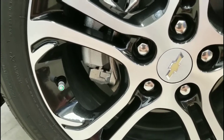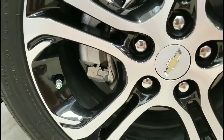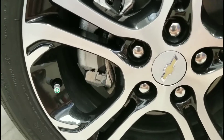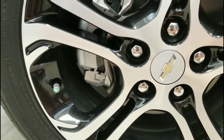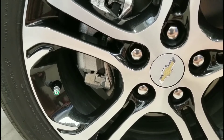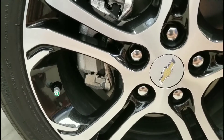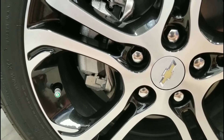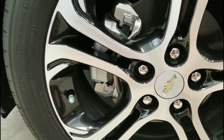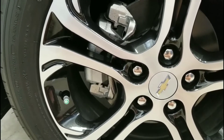I don't necessarily think they're filling your tires with nitrogen because it's a Formula One car and it makes you corner better. I think the idea is simply that it maintains tire pressure more stable. Therefore, you'll possibly get better fuel economy because your tires aren't underinflated, and your handling will be consistent because they're not overinflating when they get hotter. I think that's the goal.